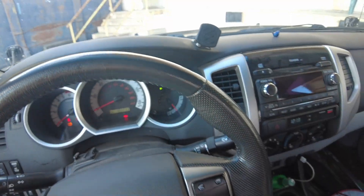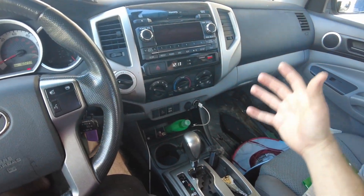Super important to note: because this is a truck and it's heavier up front than out back, I run different pressures front to rear. It's not really a problem on the system — once the rear tires reach the pressure you want, you just disconnect the rear tires and then the fronts continue airing up. Obviously we can turn the compressor off and on from in here in the interior.